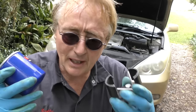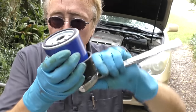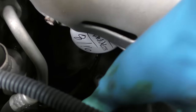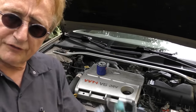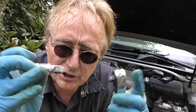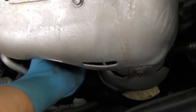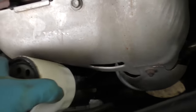When it comes to getting the old oil filter off, you want the right tool. I find these metal ones are really handy — they open up, fit on the filter, and you can easily unscrew them. You don't have to mess around with thin metal breaking or plastic crap. In the case of this Lexus, the filter is easy to get to — it's under the exhaust manifold, which is another reason you want to do it when the engine isn't red hot, so you don't burn your hand. This just slides over the filter. Since it's recessed, we use the ratchet with a little extension to have enough room. Then you turn it and it's loose, and it easily spins off with your bare hand. Turn it sideways and up it goes.